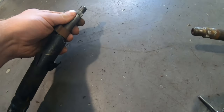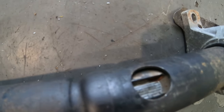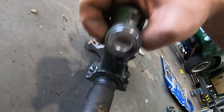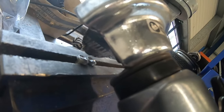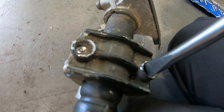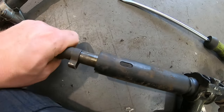That old column is actually really stiff to turn, whereas the new one is so much easier. So I'm going to say that's probably a lot of the problem, if not all of the problem. You can see in here - this is the hole that the ignition barrel goes through, and that cut-out is what it should sit in. First thing I've got to do is put that back on there. That is the steering lock working - it actually locks the steering.